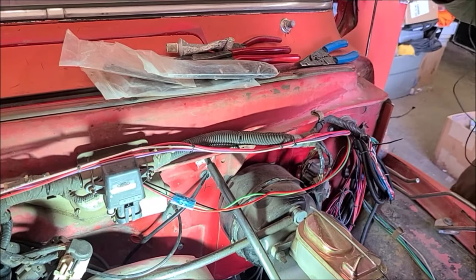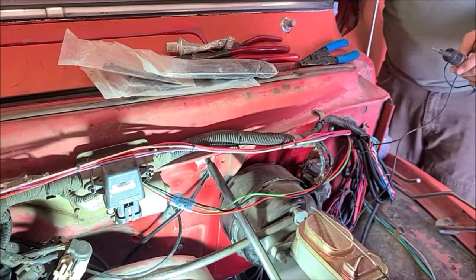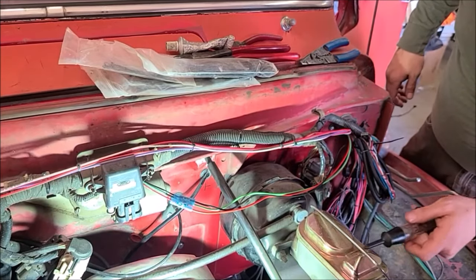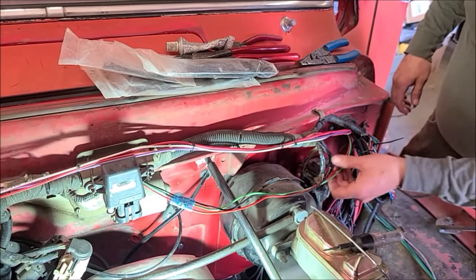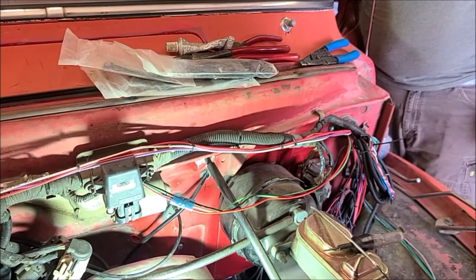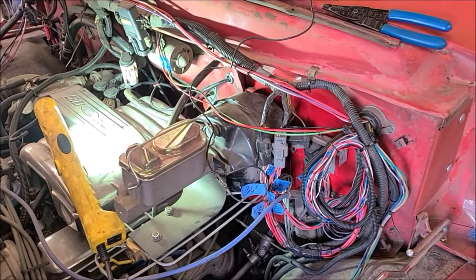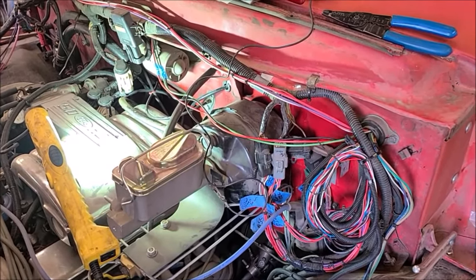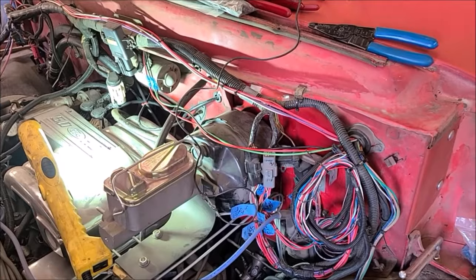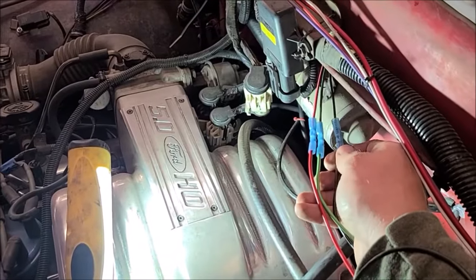They don't sound very good. Did you guys see smoke? Because I smelled smoke and I think I saw it — so that's not a good sign. And it doesn't look like it's parking; the second I turn it off, it just stops. When I run the motor on the one speed that does work, smoke is starting to come out of the motor. Best I can tell, the wiring is correct: I'm getting power to black when it's off (park), power to red on low, and power to green on high.